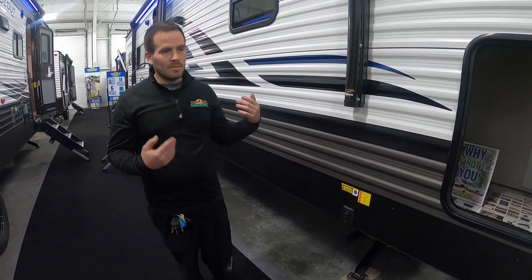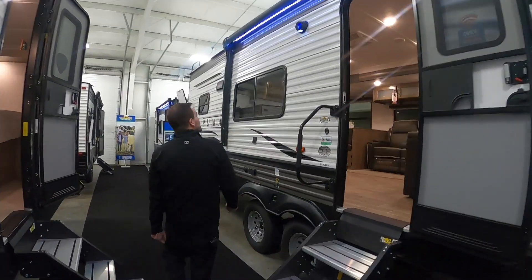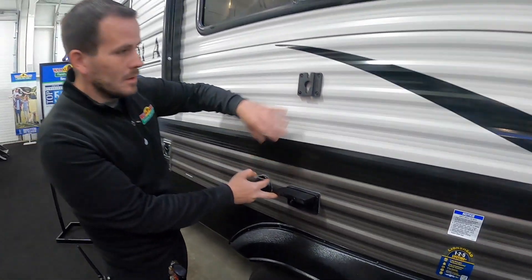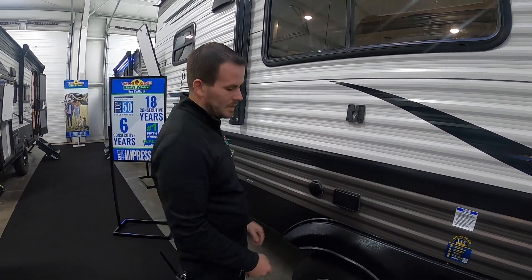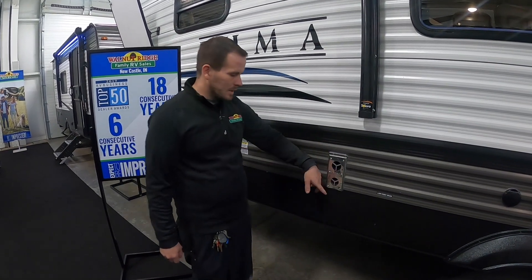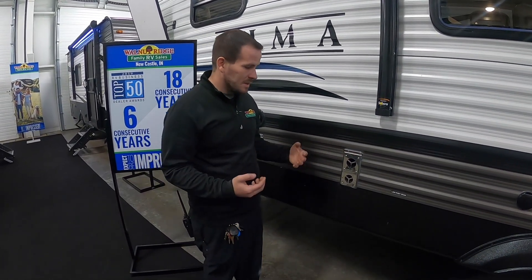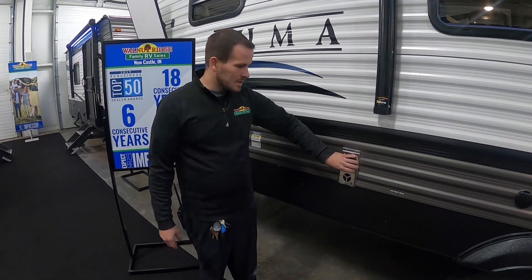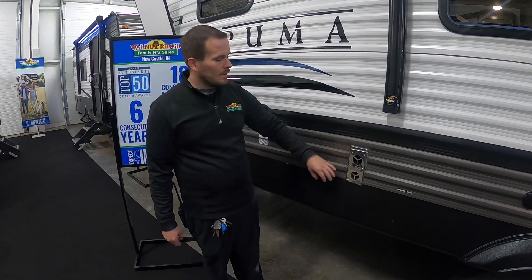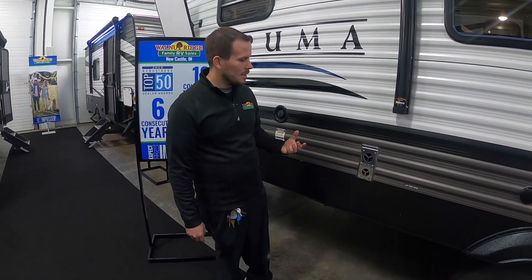Don't put too much force on them and always make sure they're up before you tow away. This has a power awning with LED lights, outside speakers, outside lights, and outlets — actually made for a TV to go out here with a coax for antenna TV. The furnace exhaust vents are on the outside. You might blow these out with a compressor every few months. The best thing to do is put mud dauber screens over these — they're easy to put on and prevent mud daubers, bees, and stink bugs from getting in and backing up the squirrel cage or building nests that break fins. Put those screens on and every once in a while stick an air gun on top and blow it out.